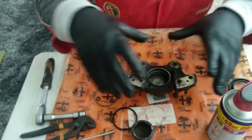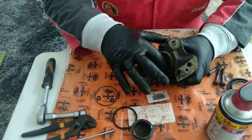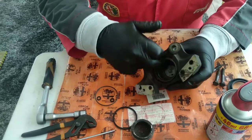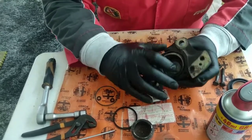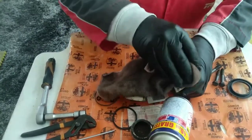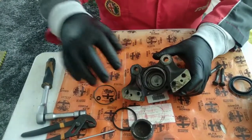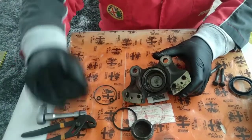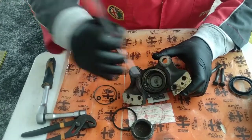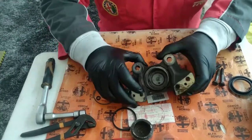What I like to do is to clean very well these holes, but don't clean them too well — if you scrape too much you will take out the plating and the part might tend to rust much easier. So clean out only the dirt, with whatever you have that can reach all of these corners. Okay, it's very clean.